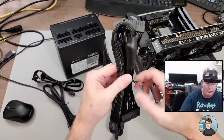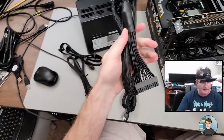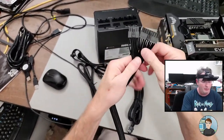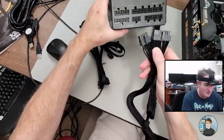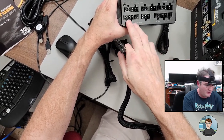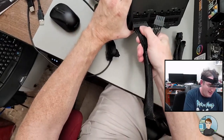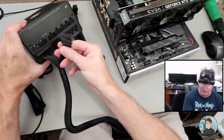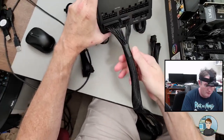I've had computers brought to me probably three or four times with this issue. The 24-pin plugs into the motherboard — it's two separate connectors. It's got 18 here and six there, which makes 24. I've had people only plug in one of these and leave the other part out, and then the computer doesn't power on because it needs all 24 of those pins.